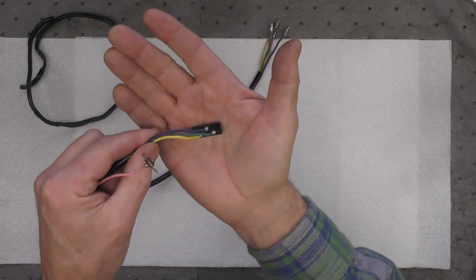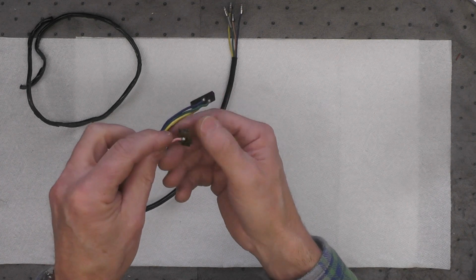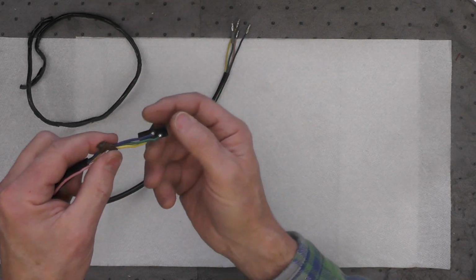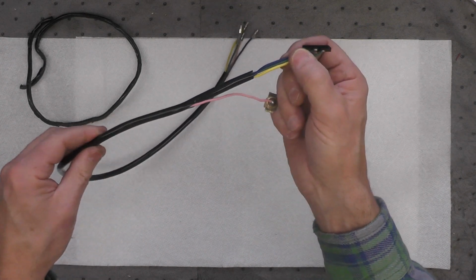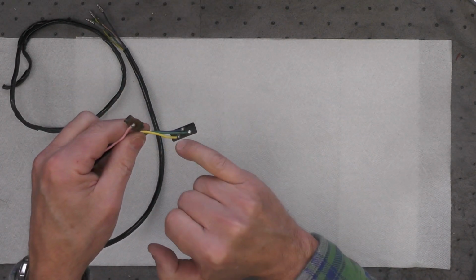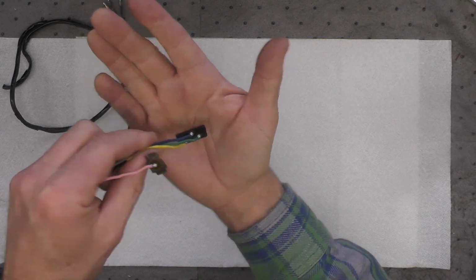And I thought that was the cleanest, simplest, and less invasive option. And it came out really good. I had no trouble then getting the wires through individually. I used a little dielectric grease, of course, to lubricate the insulation on each of the wires, and they pretty much pushed right through. And I just resoldered all the connections, making sure I had the colors oriented correctly.